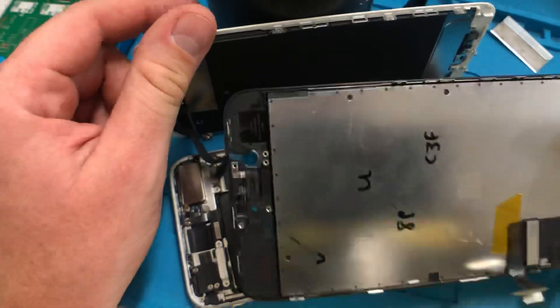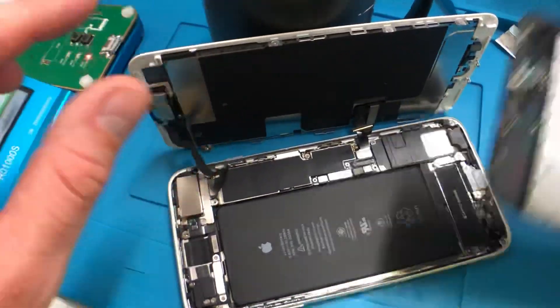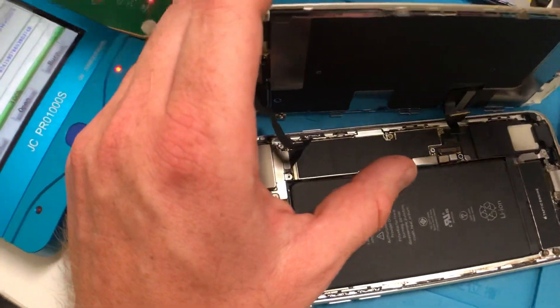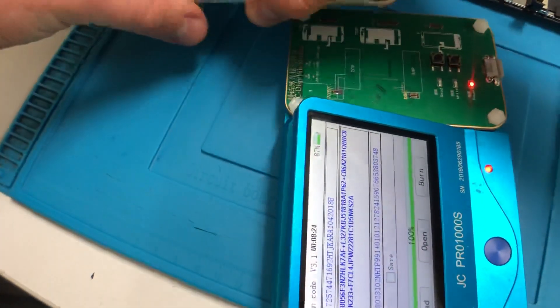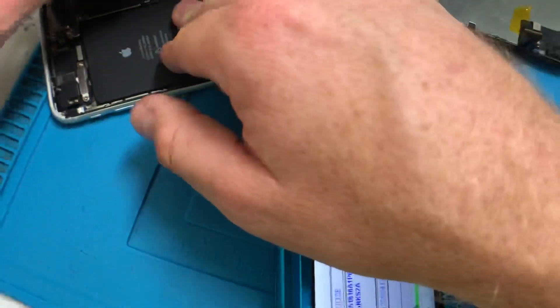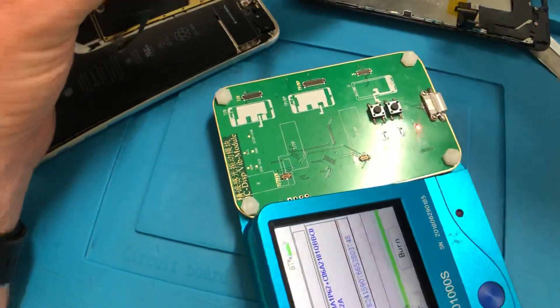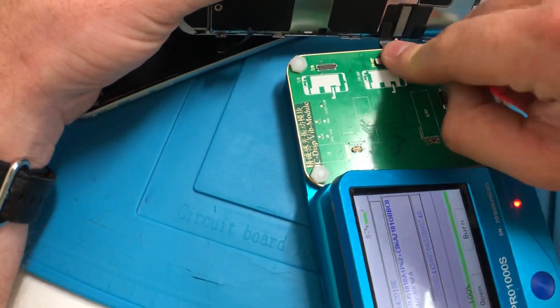This new display has the non-matching serial number. They're both C3F displays — C3F is the same as DTP, and that manufacturer is LG. There is a touch calibration issue if you mix manufacturers on the iPhone 7, 7 Plus, 8, and 8 Plus, so you always need to match the manufacturer. For the purpose of this test I've matched the C3F display so that's not a variable. So first things first, here is the serial number of the display.